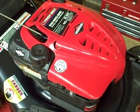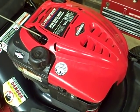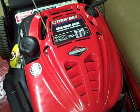It's a pretty easy repair. It just involves basically removing the blower housing and the flywheel, and then you can get to the key and replace it. This is a Briggs & Stratton 650 series engine L-head.